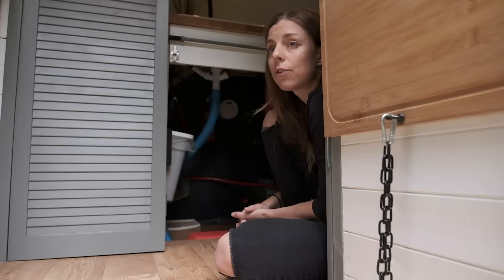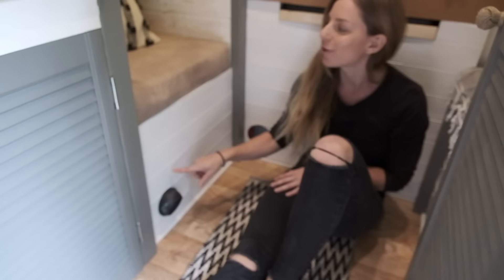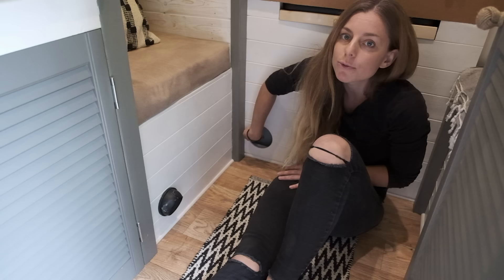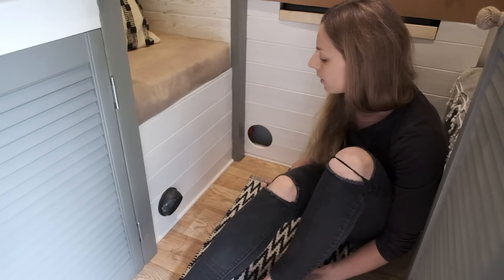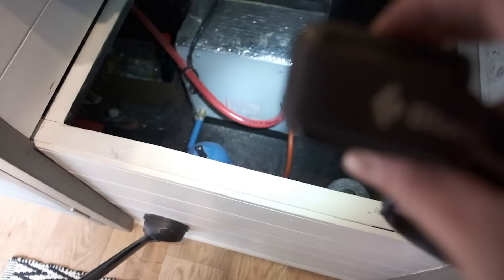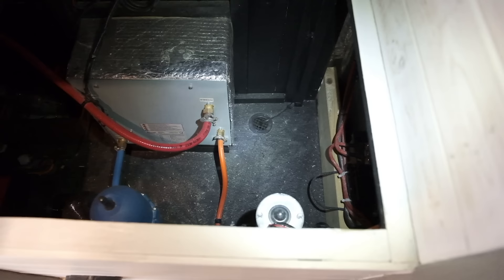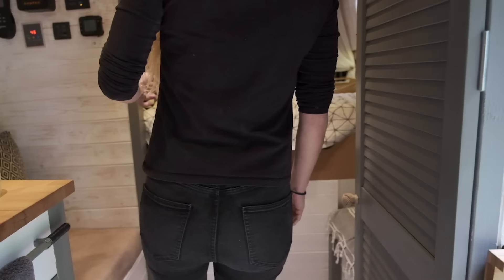Safety features include a fire blanket, a fire extinguisher, and a carbon monoxide alarm because of the Chinese diesel heater. The diesel heater is connected directly to the van's fuel tank so I don't need storage for a separate fuel tank. The heater outlet is here — great for warming cold feet after surfing. In this corner I've cut a small hatch for the main electrical shutoff for absolutely everything, so if you ever smell burning you just kill the power. Under the seat is the technical space: water heater, Chinese diesel heater, water accumulator, water pump, drop vent, and the leisure battery — all visible and accessible, kept clear for maintenance.